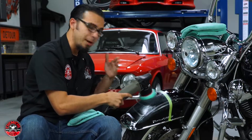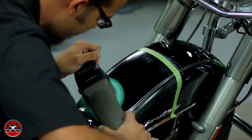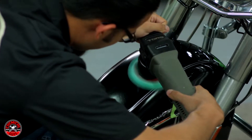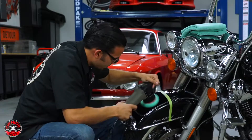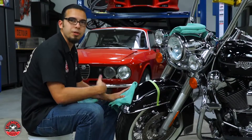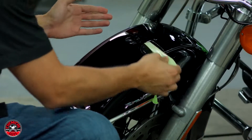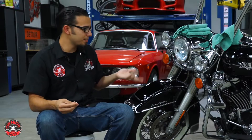Now that I've spread it out, I'm going to bump it up to speed setting 6. The proper technique for polishing is to go up, down, side to side, and overlap your last pass by at least 50%, keeping that technique until your polish has gone clear. As I was polishing you may have noticed the compound started to turn clear - that's how it tells you the compound is broken down and you've done enough polishing. When you're done, buff off the excess compound. I've finished polishing this fender area, so I'll take the tape off so you can see the difference - this side has less scratches and swirls and a lot more gloss, while the other side still has scratches and the paint is kind of dead. All that's left is to do the rest of the bike.